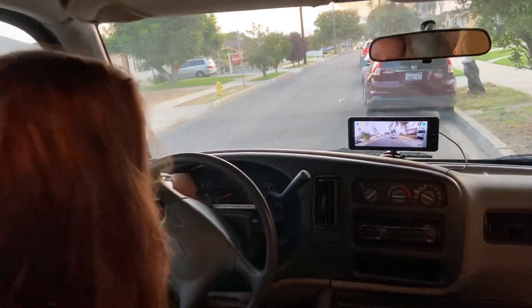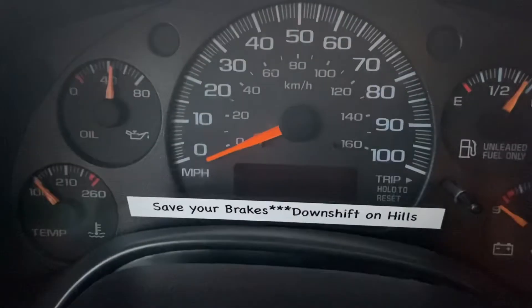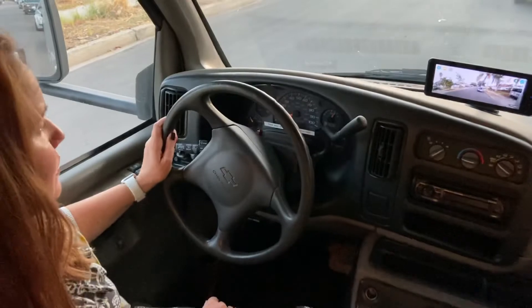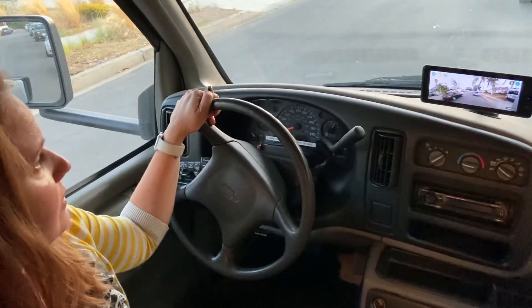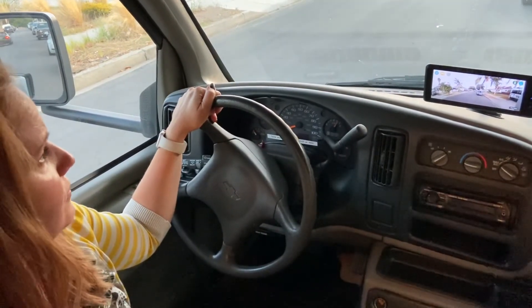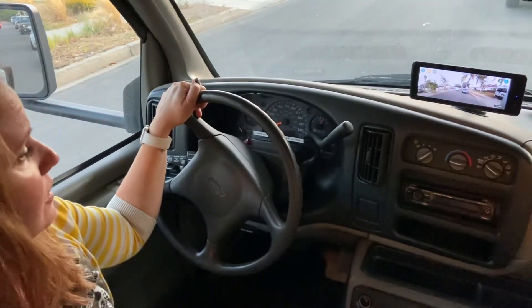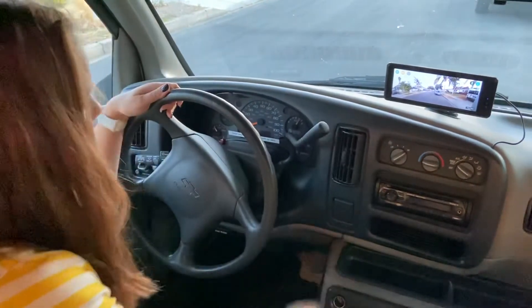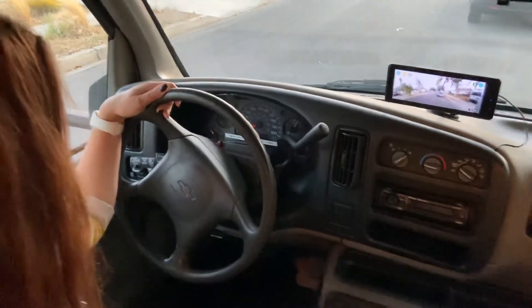There is a nice little sign here on the front that says: save your brakes, downshift on hills. One of the biggest issues and calls we've gotten is when people forget this simple step. If you're going down a big hill for a long distance, you've got 15,000 pounds against your brakes. To save your brakes, you just downshift into second gear and you'll let the engine brake for you instead of using your foot.